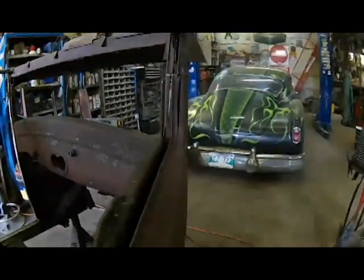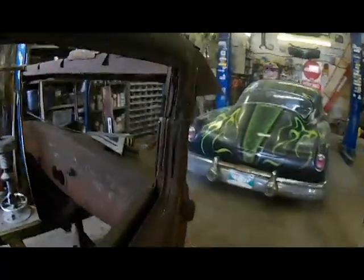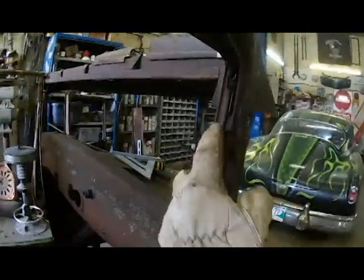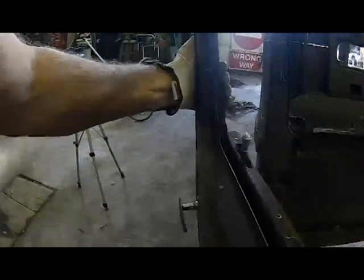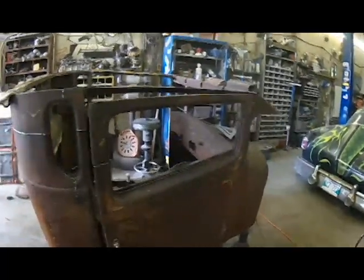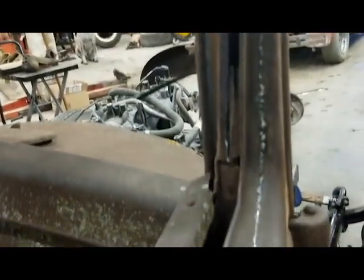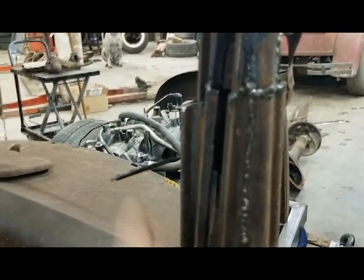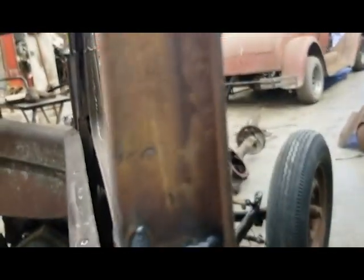The problem I have is nothing lines up — like the door. You're going to have the windows roll up and down. Not that this is going to be anything really fancy, but the idea here is all these bits will move over. See, this had to come in, this has got to go out, these got to go in, this has got to come out — same on this side. See that goes there, this was over there, so now I'm kind of lining this up. Got to fill everything with weld. Hopefully the windows will work okay-ish when it's said and done. You can see how the door is all lined up after. Still have to weld something in there — it's mostly going to be for the window channel. You can see how I spliced some pieces to make everything line up.